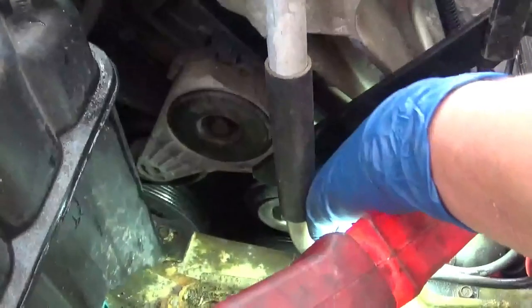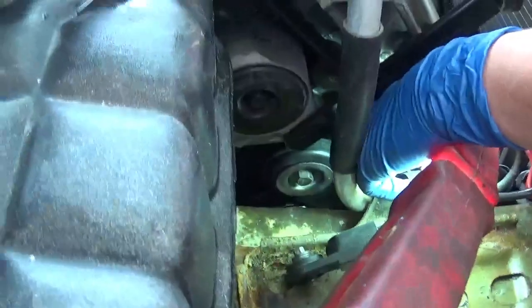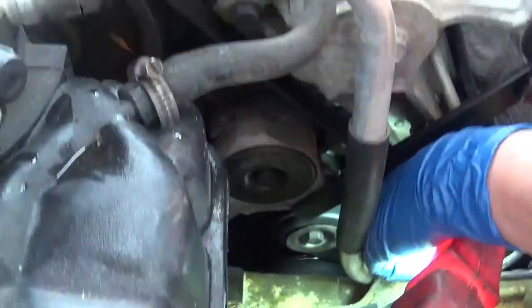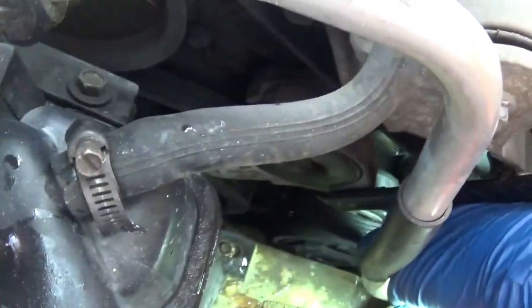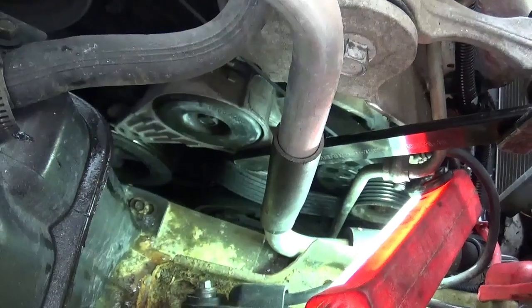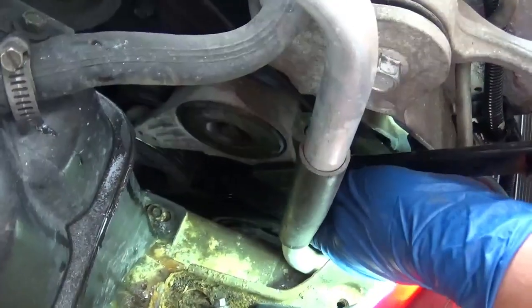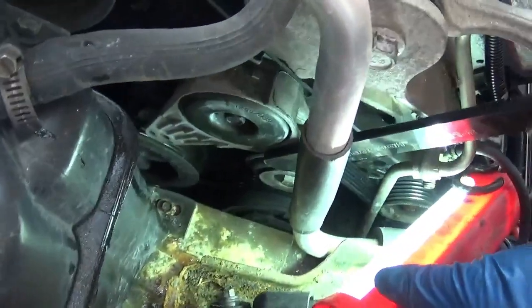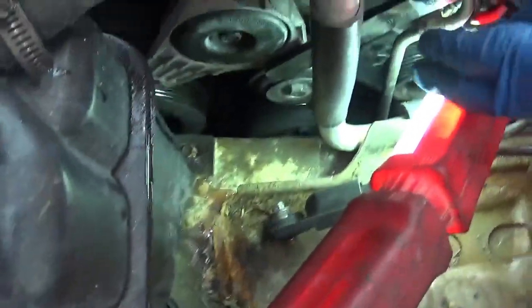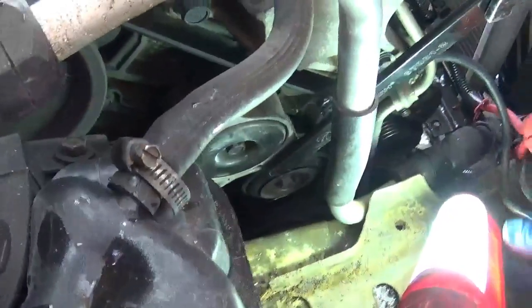Now look down here at my left hand. See right here where my left hand is? Oh, you have to go back towards the back a little bit. Right there, with the tension off, I can just slide the belt right off of the idler pulley right there. You see how it's off right now, Jake? Yep. That's when it's off, and I'm going to put it back on. I'm going to block the light a little bit, and back on. Boom. It's just that easy. The serpentine belt tool. Well, we get quite a good shot. So. Okay, let's do it again then.